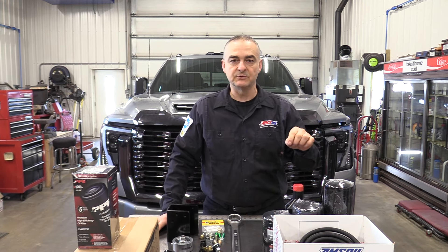This is a Mishimoto filter adapter that goes between where the original filter was and where the new filter mounts. It's a pass-through, giving us two ports to get pressurized oil to feed the bypass filter, which makes installation a lot easier. On a previous install, I went into a port on the block, which is hard to access. This Mishimoto sandwich adapter simplifies that significantly.